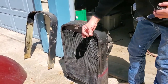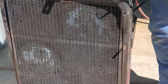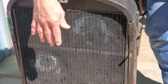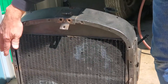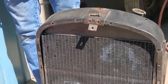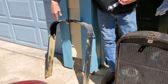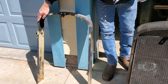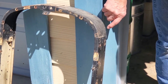Here we have these two little bolts - this one's fastened but this side has come undone. They're supposed to be welded in place because there's no way to bolt up the bracing on the front of the car without those welded in place, assuming your radiator is where it's supposed to be. This would have to be welded back. However, there's not a lot of point because we have one over here in much better shape - it's got a couple of minor extra holes to weld up, but it shows the correct relationship and the correct spot welds in place.